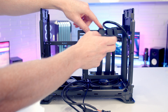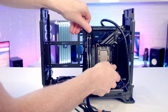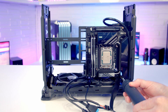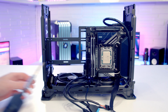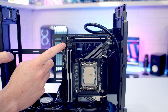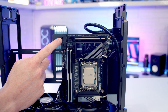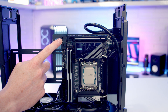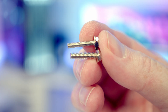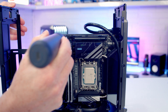We're now ready to install the motherboard. Move the riser cable through to the other compartment, then slide the motherboard into place and secure it using the flat screws from the case accessory box. A slightly unique thing about this motherboard is a button that opens the clip on the top PCIe slot, but it adds extra plastic that means one standard case screw can't be used. Fortunately, two longer screws are included with the motherboard — use the one with the bigger threads for this case.